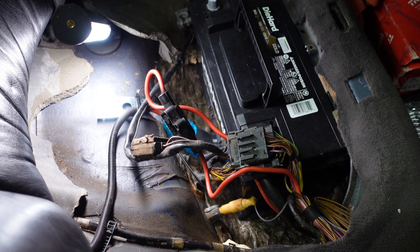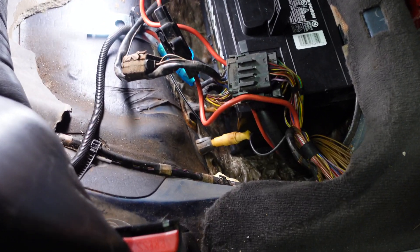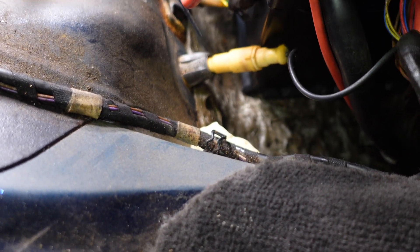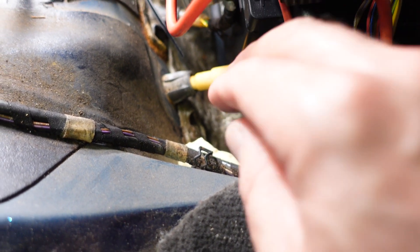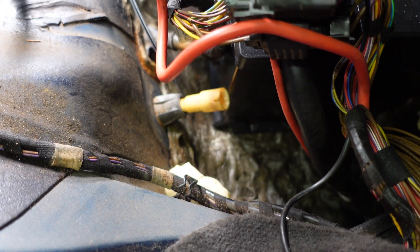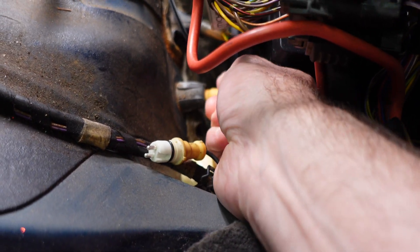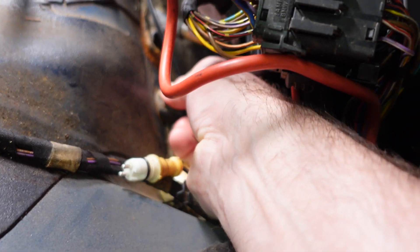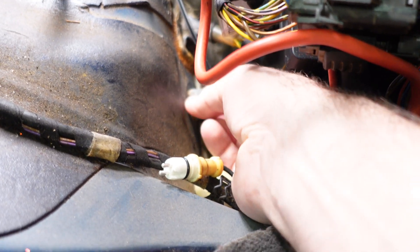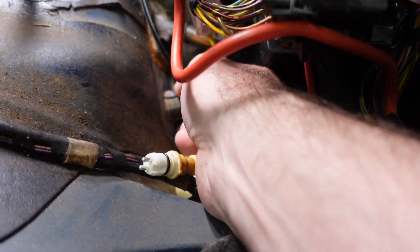We're coming to the back seat of the car in the battery tray. The goal is to unplug the ABS wheel speed sensors and free that harness. There's one plug on each side — it comes out pretty easy, you just have to pull. We want to push this grommet out, though it probably comes out a lot easier from the other side.